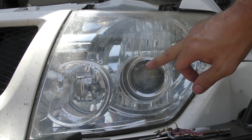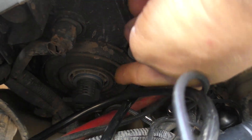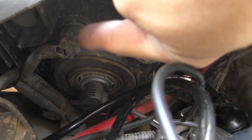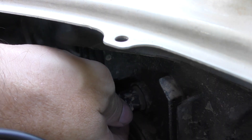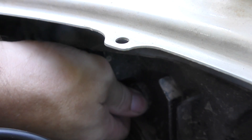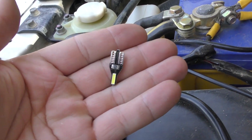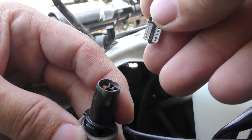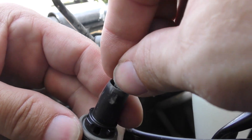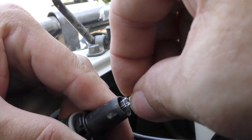This is your low beam, this is your high beam. If you have a look, you're pretty much going to go straight up above your low beam to get into the back. This is your low beam here, and this is your parker just there - literally just a case of reaching in, grabbing it. You're going to twist anti-clockwise, put a little pressure forward on it, twist anti-clockwise, and then pull back. You'll see I don't actually have anything in there - there's a little LED globe. So there's our parker, this is the little globe end - you slide it in like that.